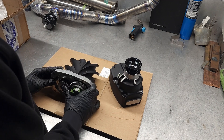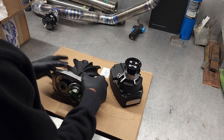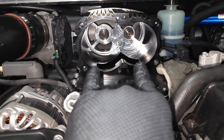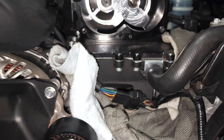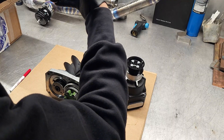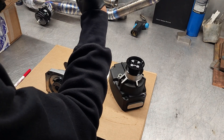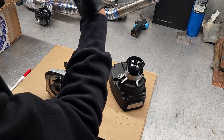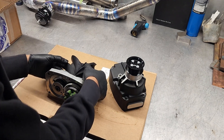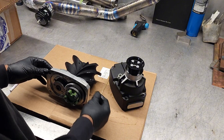For the purpose of this video, this essentially is a supercharger. This section here with the screws fits into a casing and provides a very tight seal. When the supercharger turns, the lobes interface with each other and are essentially a positive displacement pump. They take a large mass of air and compress it, pushing it out as pressurized air — essentially giving you boost, more horsepower, more torque.